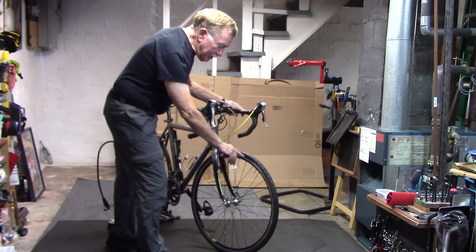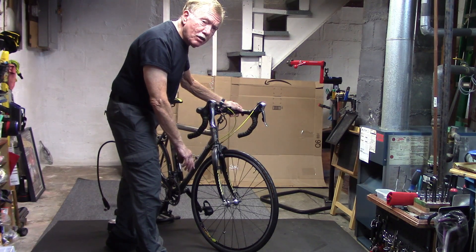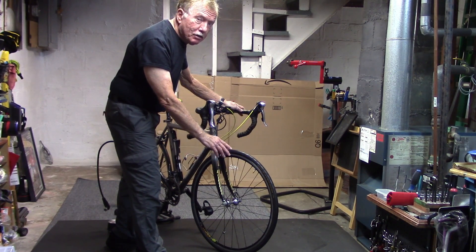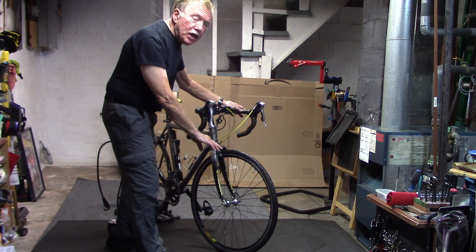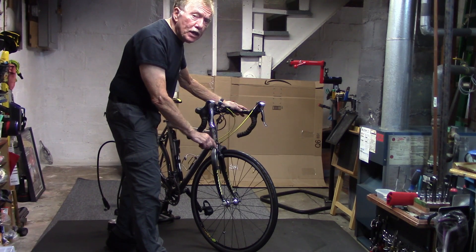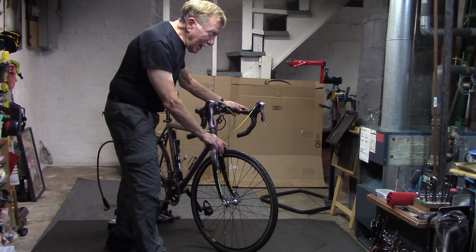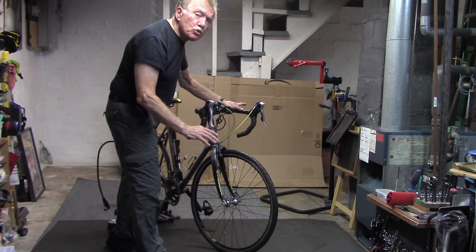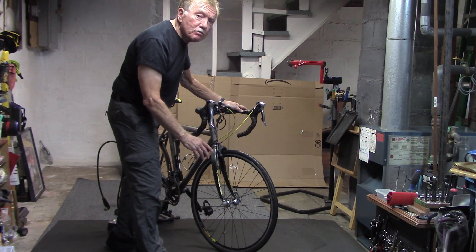Tire pressure is often written on the sidewall of the tires. This particular Continental Gator Skin only has a max of 120 — we don't want to exceed that or we're going to get a flat. When we look up on the Continental website, we can find that there is a range of 95 to 120. In our pinned comment below, we give you some details on how to figure out the best ideal tire pressure for you, depending on your weight and the weight of the bike, as well as a quick method to figure out what pressures to put in the tires, and some really important caveats such as when it rains, or it's hot or very cold.